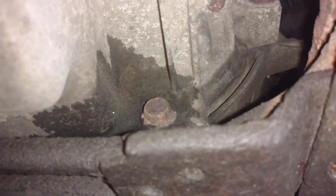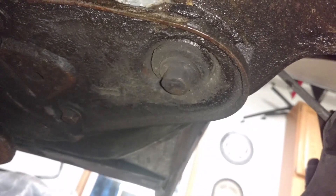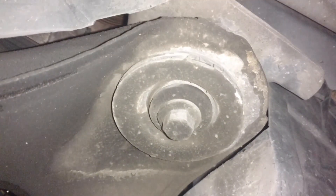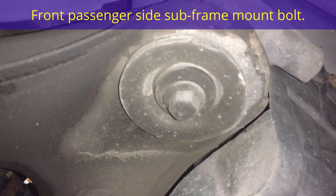I took a couple bolts out of the transmission up top, and I took the bolt loose on top of that mount. Coming under the vehicle, I took the transmission torque mount loose and took the bolt out of the power steering line. Now I'm going to hit some bolts around the transmission down here. Take the two 14s from there, 18 there, 18 there, two 14s from there, 18 there. We're going to take this one down about two inches so it'll all be hanging from this bolt here.